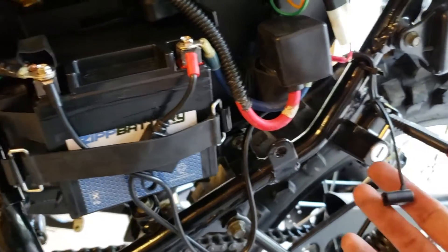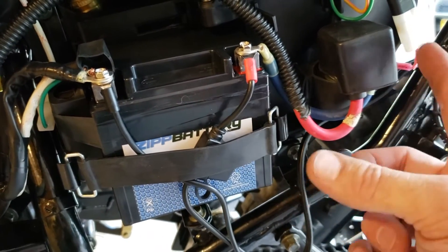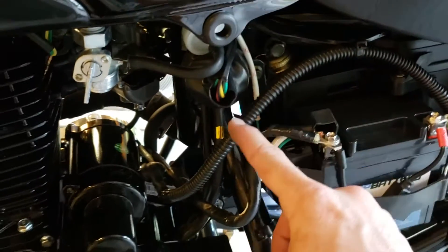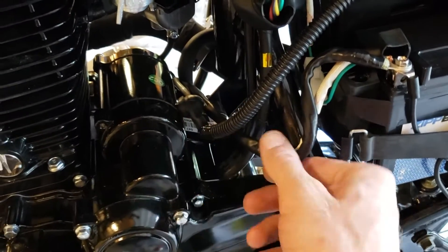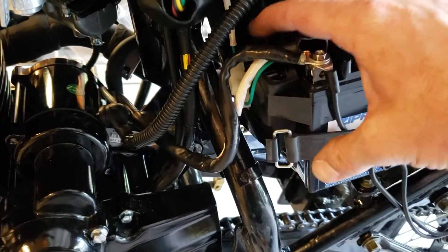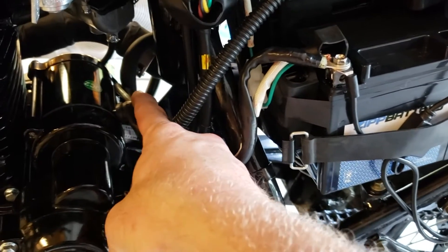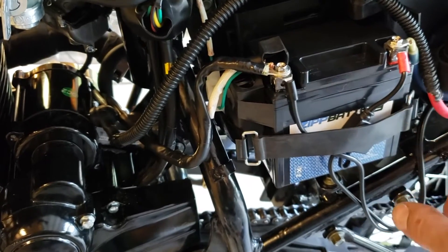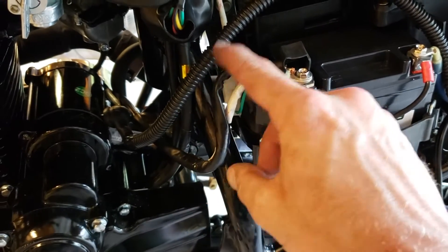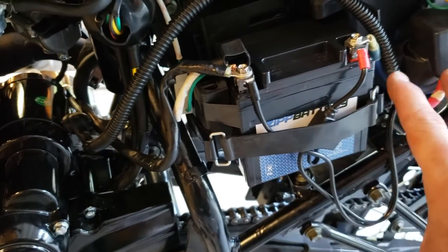Coming off the battery I've got very large six-gauge cable. This blue six-gauge wire runs into the solenoid, then another large six-gauge cable runs up over here and connects to the starter, completing the circuit. For the ground wire, I didn't have a large enough cable sitting around, so I left the stock ground wire that runs to a bolt on the other side of the engine, then took the wire I removed from the starter circuit and cut it to the same length — basically doubling up the wire to make a larger ground path.